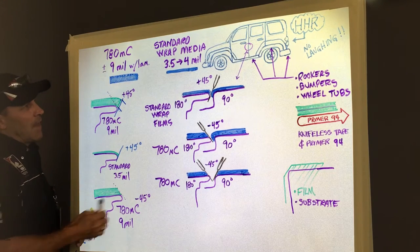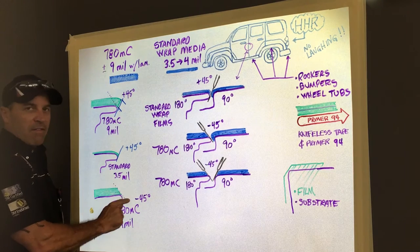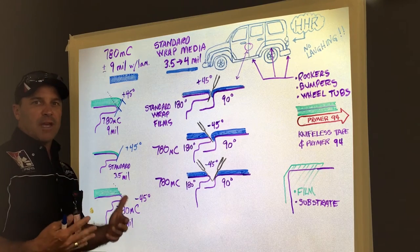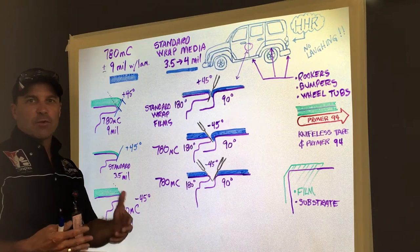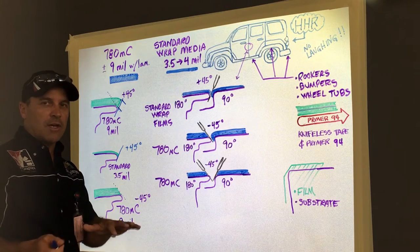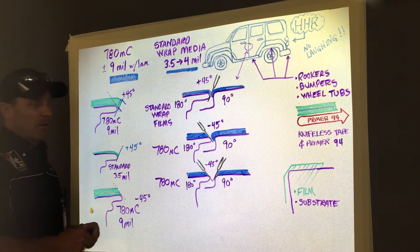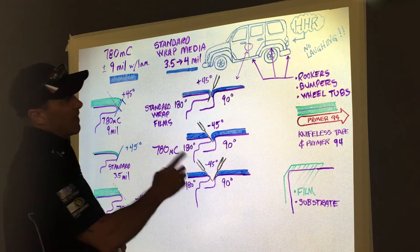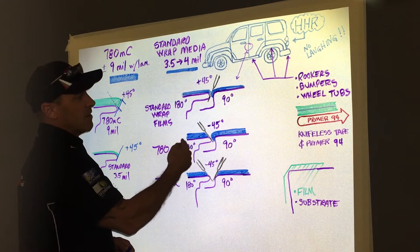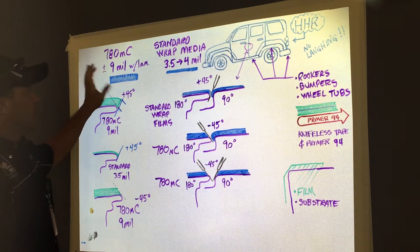To eliminate the possibility with the 780 film of having that scenario where you can actually get that material to lift by getting a hold of that hard edge, I'm going to suggest that we change our cutting technique on the jams to a negative 45-degree angle. What you're actually going to be doing is creating a bevel on the 780 film that's going to run in the opposite direction of the turn. Reflective is not paint or color change film — it's reflective, and it's going to behave differently than standard wrapped films. There are going to be behavioral differences between standard wrapping films, digital medias, and reflective films, just because of the density and thickness required to build the retro-reflective mechanics into that material. My suggestion on the jams, on the 180 side, is to change your knife trajectory from a positive 45 to a negative 45, creating a bevel in the opposite direction, which is going to eliminate the possibility for anything grabbing the high side of that turn.